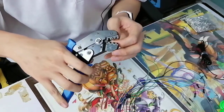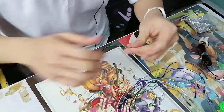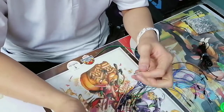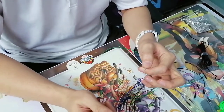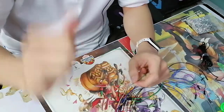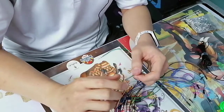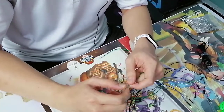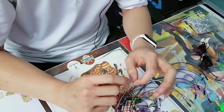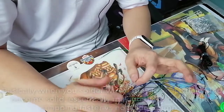I usually do a few rounds to make sure. So, what have I learned from my previous control experiences? One, don't solder. Previously, for all customers, I would normally solder crimps to the wires because I thought that would make the wires way tougher. That's a mistake, because when you solder, you make the wires too hard, and then it just refuses to work.